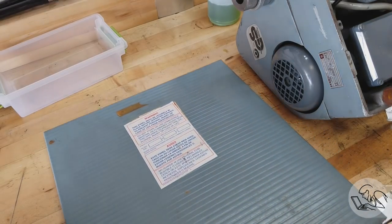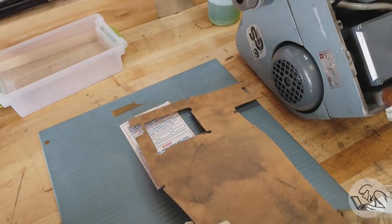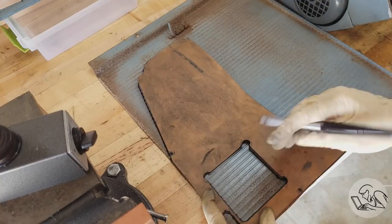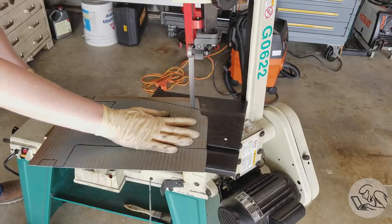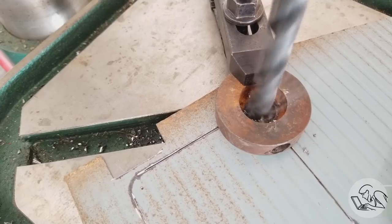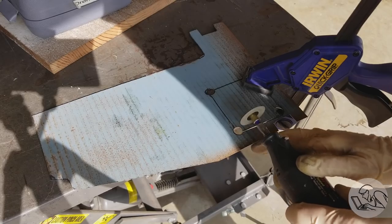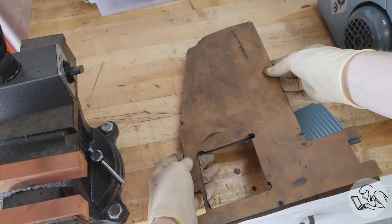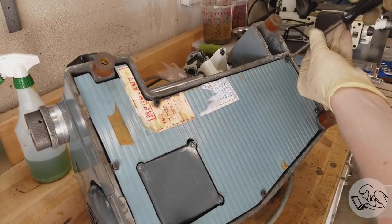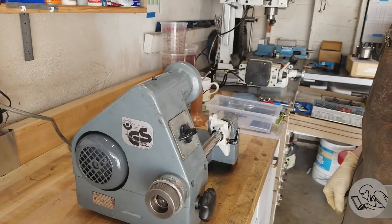This is a piece of sheet metal I salvaged from an old furnace in this building. The original cardboard bottom is in very bad shape — it's warped and the screw holes are all torn out — so I'm going to remake the bottom out of sheet metal. I trace the original onto this piece of scrap from a furnace built in 1962, cut the basic outline with the bandsaw, drill out the corners of the oddly shaped opening, then connect the dots with the diamond wheel on the Dremel. That came out quite nicely. We have a nice fit for the original part. I flip the grinder over and run it just to make sure the sheet metal doesn't rattle — and nope, it runs really quietly. We're all set.